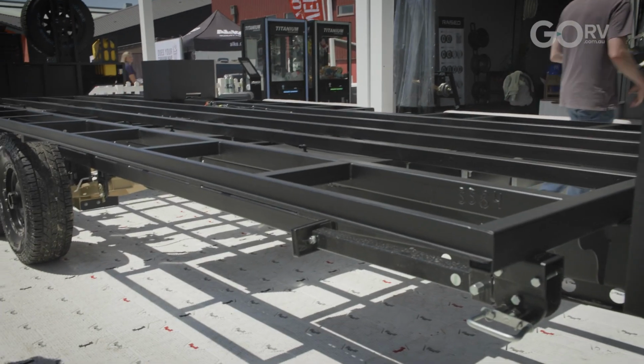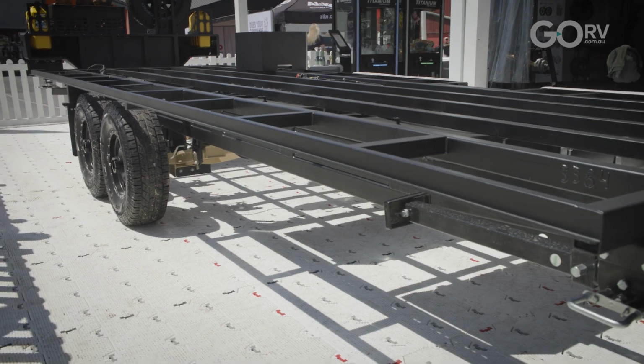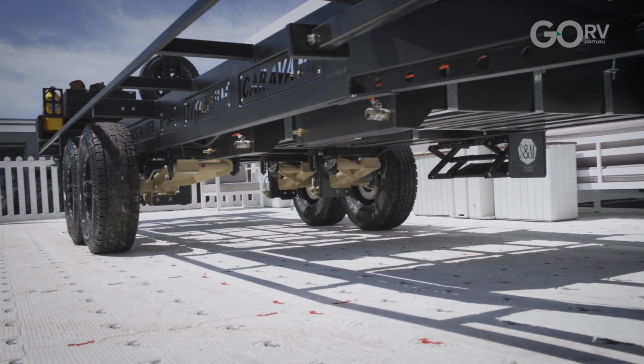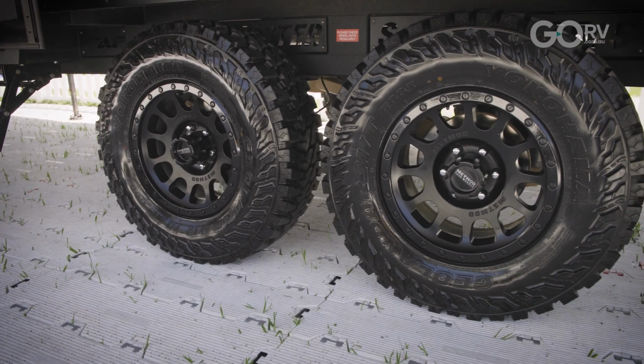Tell me about how you build the caravans. What sort of framing material are we using? This one's on a truss chassis, giving you that little bit more clearance, obviously more space with no wheel arches for storage and battery space underneath the couches. And then we're using aluminium framing, and we use a honeycomb flooring, which is one piece, which is fantastic. It's timberless, so with splashing or driving through water, you're not going to get any rotting, and then the aluminium frames.